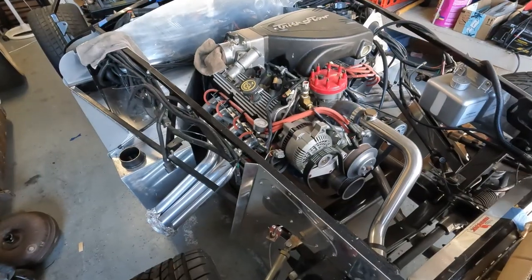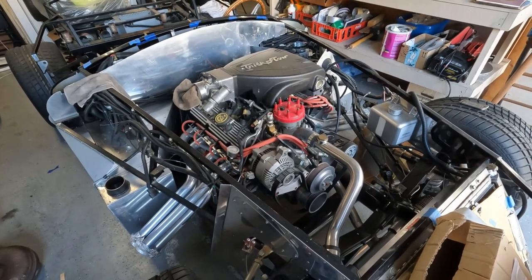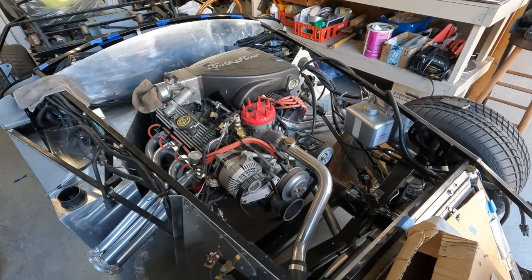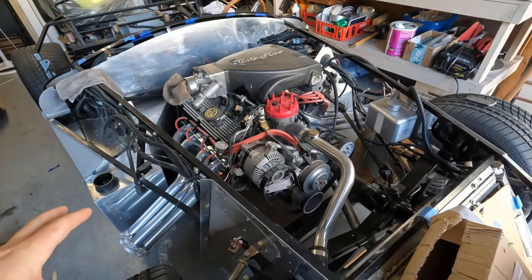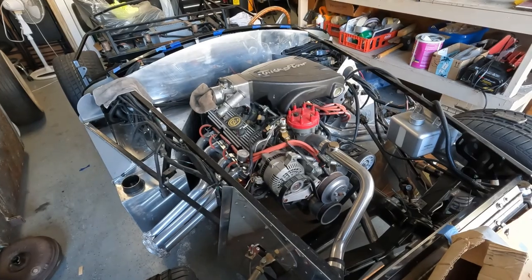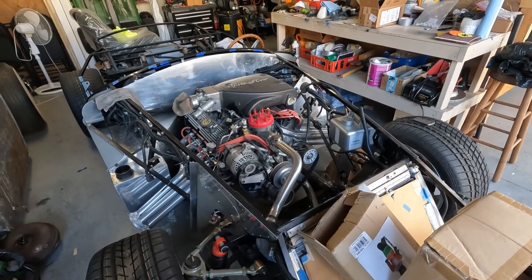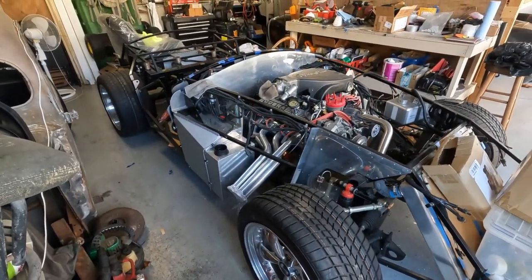What I'm looking at? Yeah, it's a Ford 302 5.0 engine. It's got a total heads, manifold, cam, Trick Flow package, 350 horse Trick Flow, Street Heat intake. And basically the bottom end came on it. Right, so we did a top end rebuild with the Trick Flow aluminum heads, 2.06 Twisted Wedge heads. The Trick Flow Stage 1 cam, which is a dual pattern cam. Basically, it's going to be in the 350 range horsepower.